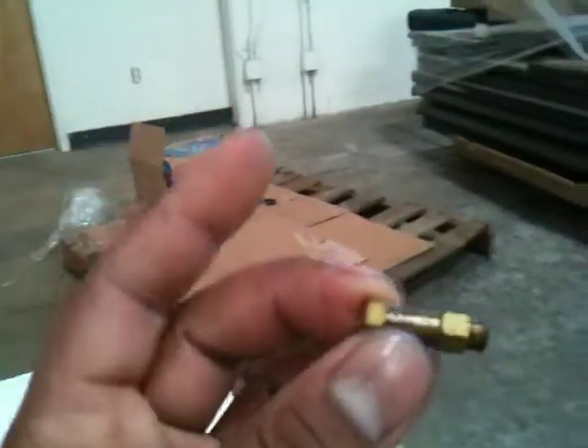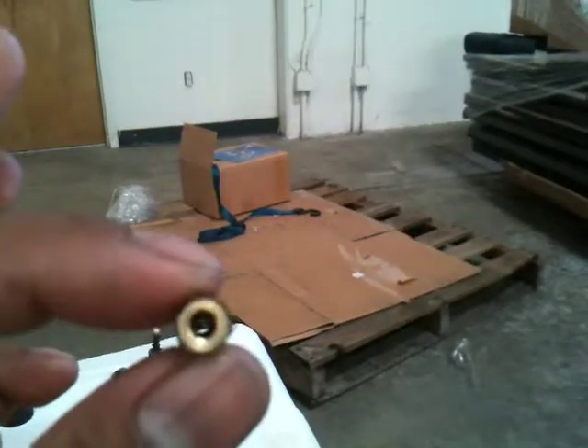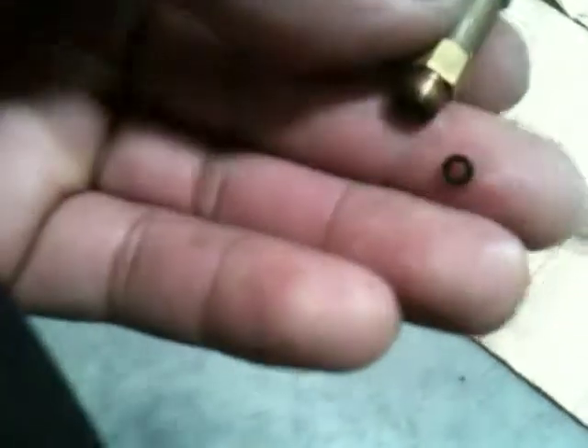Take note on this piece — I forgot to inform you guys, there's a rubber o-ring inside. Make sure you take that out first or you don't lose it. I'll show you what I'm talking about. Using the pilot jet, I'm going to try to push the o-ring out. And there's our o-ring. Make sure if the o-ring is cracked, that needs to be replaced. Make sure you do install it — without the o-ring the bike's not going to run right. So keep this, put it aside. Let's put it next to the brass washer so we carry on cleaning.